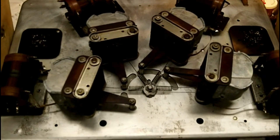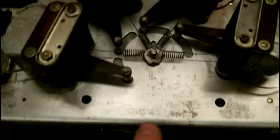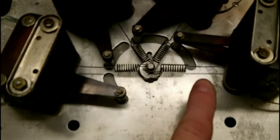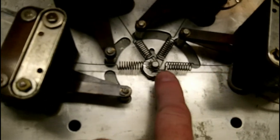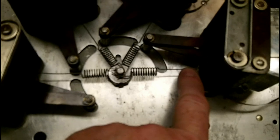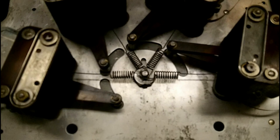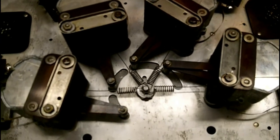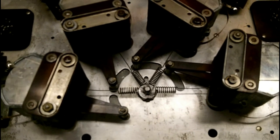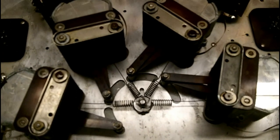I'm going to show you something. I made a mistake and none of you guys caught it. I was watching my own video the other night and I noticed that when I put these springs back, I put them on backwards. I've since corrected it, but originally I had the long wire connected here and the short spring close to the body — and that's backwards. It wasn't until I watched my own video that I realized it. So I had to flip it back over, correct the springs, and get ready to put the can covers back on. That's a good reason to watch your own videos and also to refer back to your photos, because I did go back to my photos and sure enough, they were backwards. I caught my mistake.